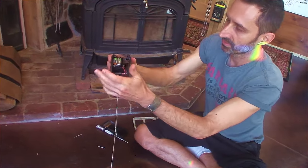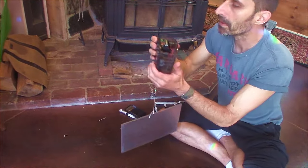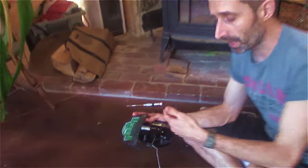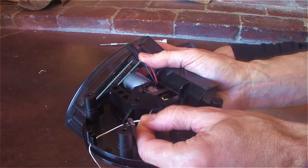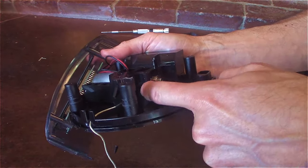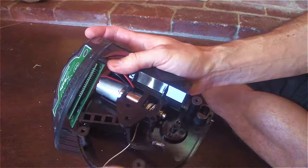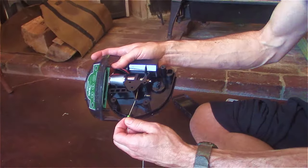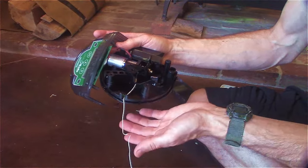I love tech that you can fix. Let's see — is it spinning up? Something's spinning in there. All right, so I figured out what was going on. It was trying to pull up the door but it wasn't moving. Right in here is where the string passes from outside into the chamber that has the spool, and what I did was accidentally clamp the string down between these two pieces of plastic. You want the string to be all the way to the back — there's a little notch that allows it to move freely through that area.